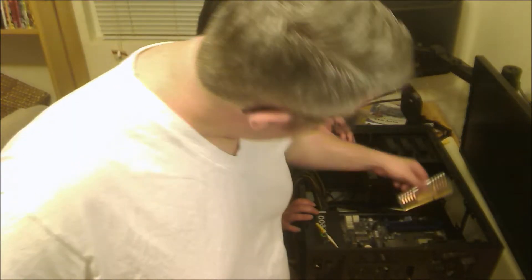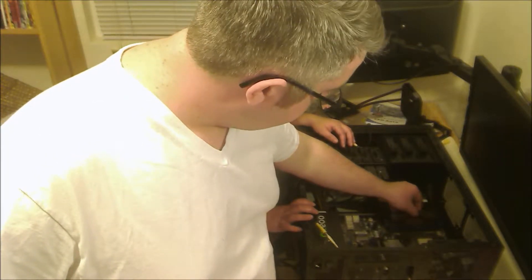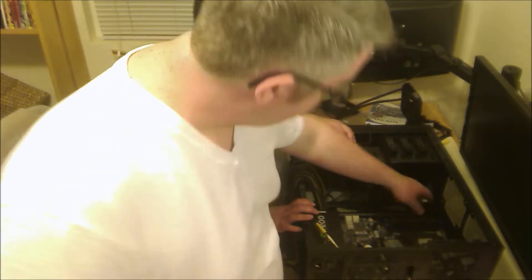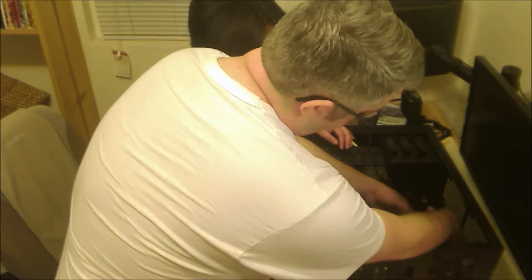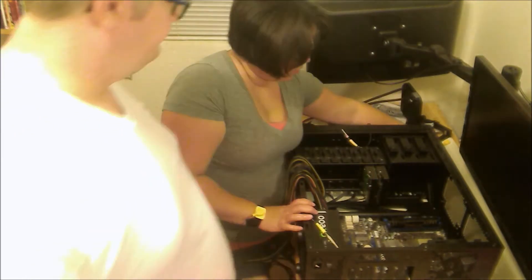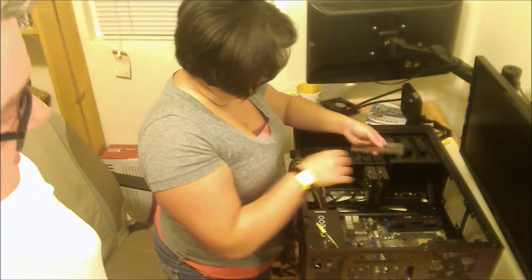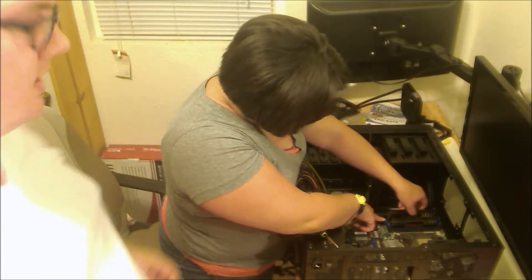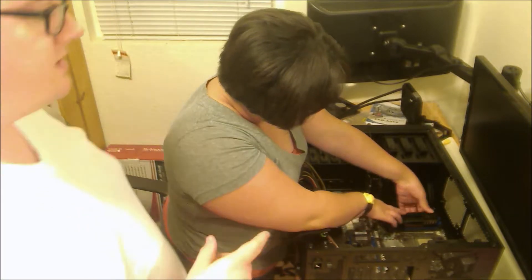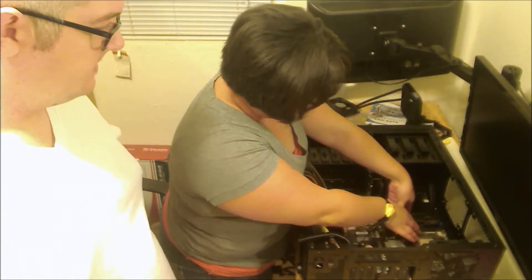So you always want to remember when you push it in, there's a thin end, a short end, and a long end. And Meg taught me that you use the blue ones first — well, you have to look at the documentation for the motherboard. You just push the RAM in until both of the clips snap. I was just putting RAM in whatever, but supposedly there's a thing.